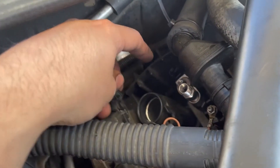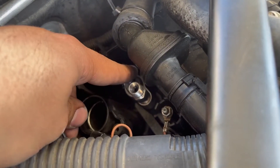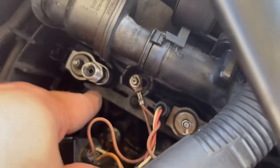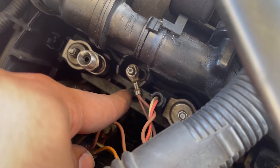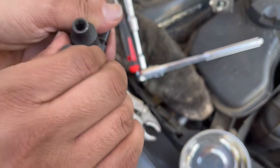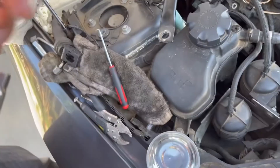As you can see, the plug has been removed. Sometimes this little plastic clip can break if your injectors are old — that's okay as long as the prongs are still there. Next we're going to remove that bracket right there. It's just one bolt for two injectors. I believe it's going to be an E10 — let me double check.